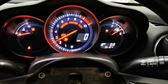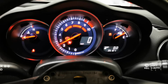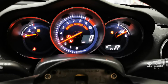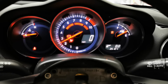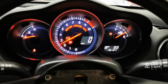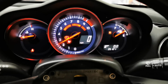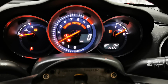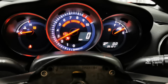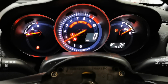You may also see the DSC flashing light there. That's wonderful. That's because the DSC needs to be calibrated left and right for the wheel alignment, so that it knows when the wheel angle is different from the requested angle, and therefore the DSC can kick in. So that's literally just a case of whiz the wheel to the left, whiz the wheel back to the right, and then back to centre, and that'll go away. And then when I turn the engine off and back on again, the traction control warning light on the right over here, somewhere, there, that will go away as well, and then we'll have traction control back again.